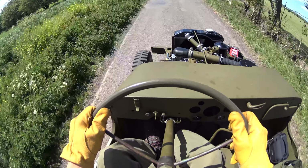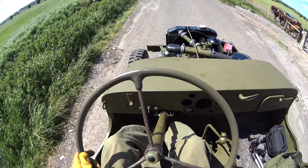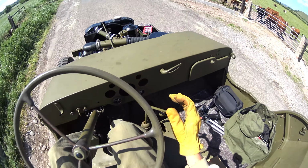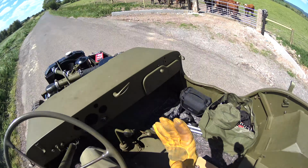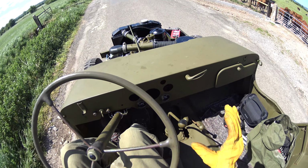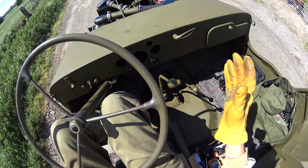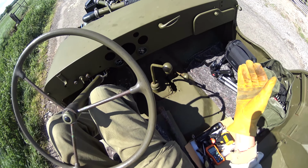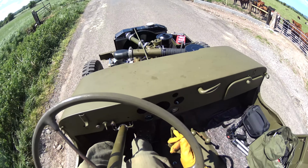Yeah, quite something, hey? It just leaps off. It's incredible. So yeah, it's really healthy jumping there. First into second that was. Now, oh hello, there's a good audience. Now it might seem like the second gear is fine there, but the synchros on the second and third just aren't right. They're not behaving correctly, okay? You can't really tell it there, but I can feel it. So I'm gonna have to drop the transmission on that. Tass have missed, dropped the ball there with the synchro rings. But let's have more of a drive then.